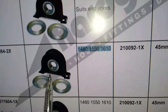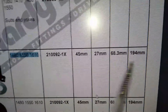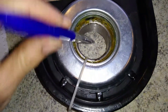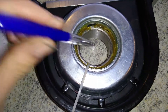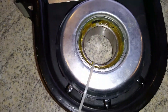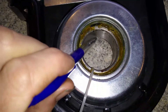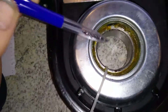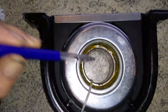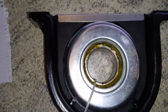The way you can track them back to finding out sizes is four measurements. First, you need to know the inside diameter of the bearing — on the Bedford NFM or SP3 and the one that we've got, that's 45 millimeters. The width of the bearing is 27 millimeters. You also need to know the distance from the center of the bearing to the top, because that sets the distance the driveshaft sits down underneath the vehicle.